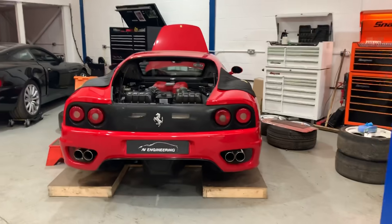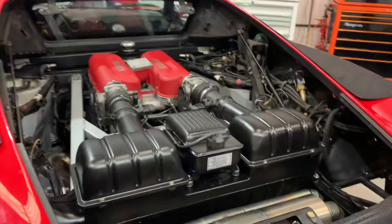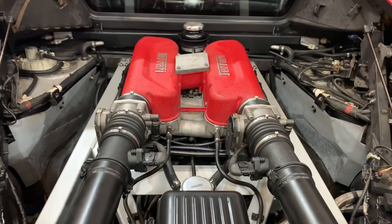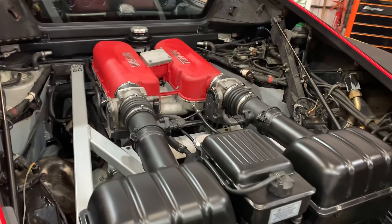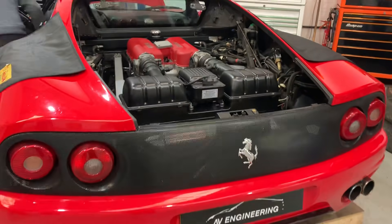The reason for the video is that we're ready to start your engine. So as you can see, it's all in and ready to go. We have already cranked it over with the fuel pump relays disconnected in order to build the oil pressure in the oil filter and generally in the engine itself. So we are ready for the moment of truth — I'm going to start it up for the first time since it's been rebuilt.